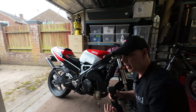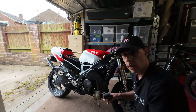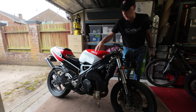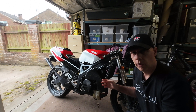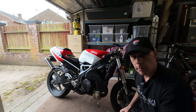These bikes operate with two independent engines running together in the same bike — it's really weird. The jetting on this carb is completely different from the jetting on the carb on the other side, and Yamaha made it that way — I don't know why. Now it's warmed up, let me check the cylinder head temperature: 46 on that one, 60 on that one. So this side's running cooler, confirming the carburation difference. I'm going to do a compression test on it.